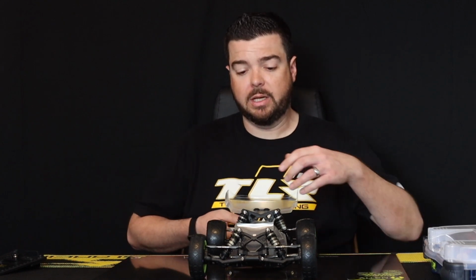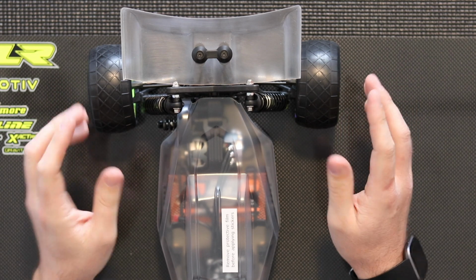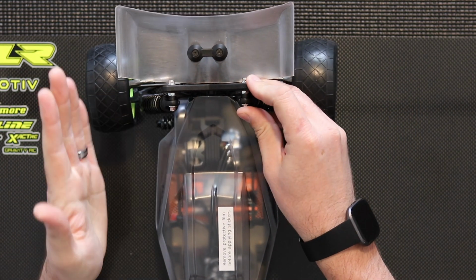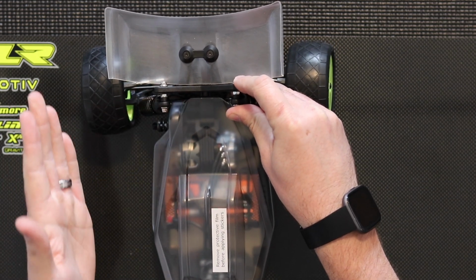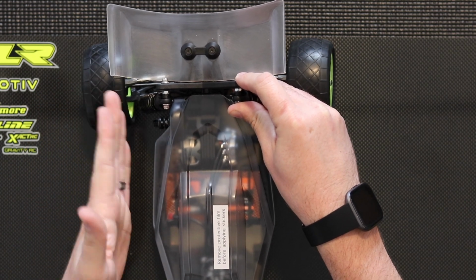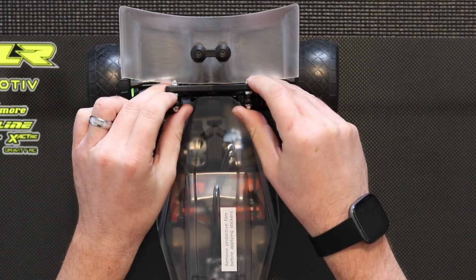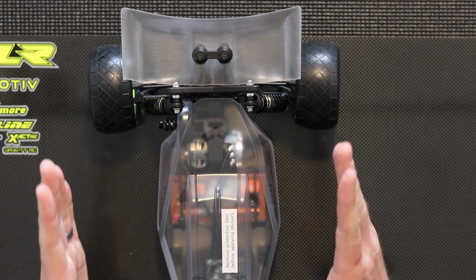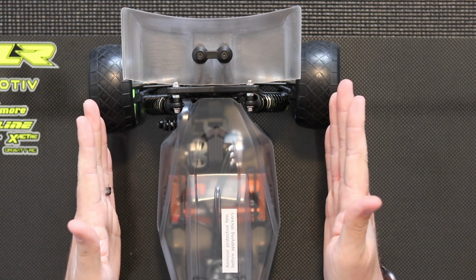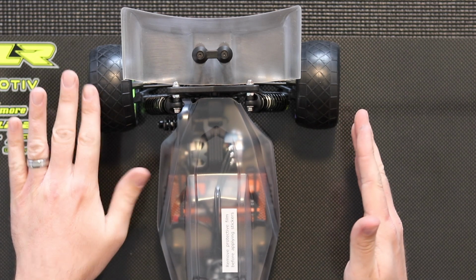All right, so we finished setting our camber and toe. You might be wondering, what exactly are these settings doing on my car when I'm out there driving? We'll do camber first. Camber is, like we were talking about, the angle of the tire leaned in. What camber does is, as the car rolls, you'll see this outside tire start to lean towards the outside. And it's a balance of trying to maximize the tire contact patch as the car rolls and as the car is flat statically. So, for example, if the car was sitting here flat, you would actually want to run zero camber,